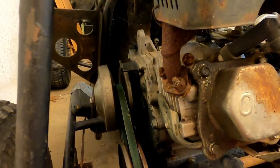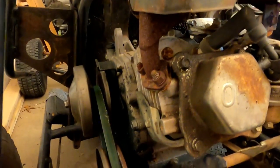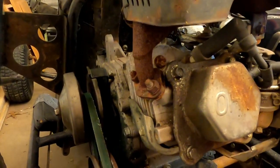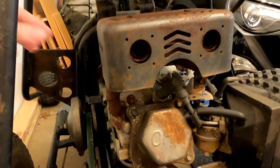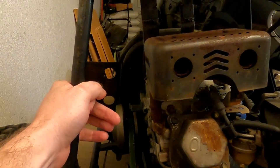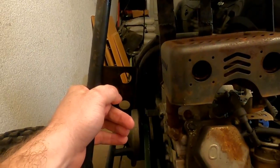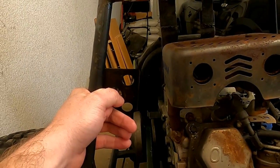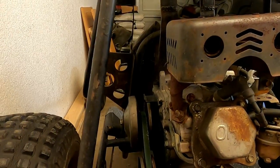I'm going to take off the exhaust, all of it. I'm going to put the actual flange in my vise. I'm probably going to get my little grinder out and grind the welds off. And I've got a piece of one inch pipe that I'm going to weld to at an angle. The general goal is to have it come up like this, and I'm going to make a bracket — weld a piece of bracket onto the cage back here to support it off the engine.